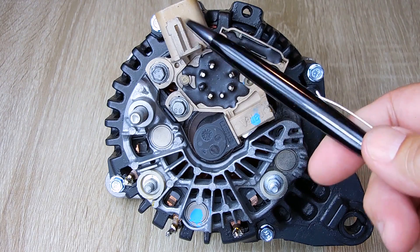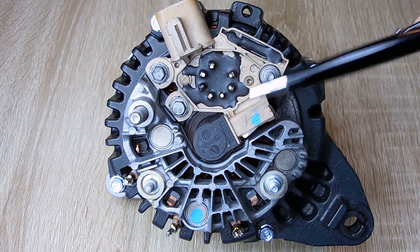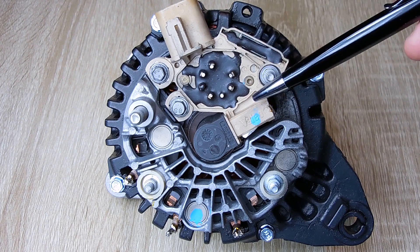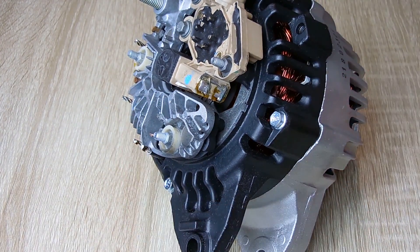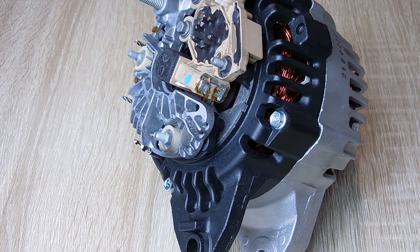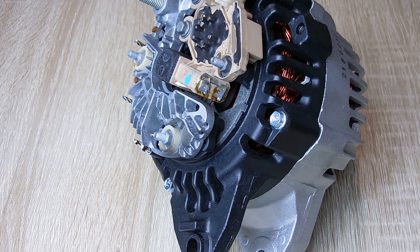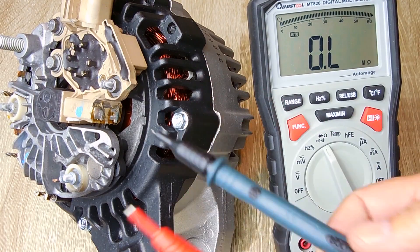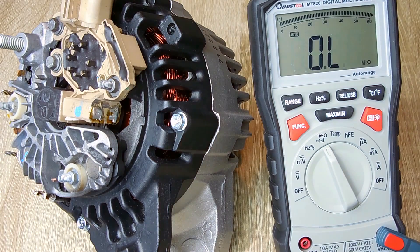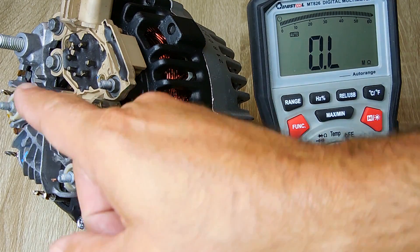With the cover off, you can now see the entire voltage regulator. Right inside these little tubes are your brushes with springs that push on the slip rings of the rotor. To make sure contact is being made between the regulator and the rotor, you measure right over here for low resistance using your digital multimeter — it's usually around 2 or 3 ohms. Touching the probes between the two points, you can see it reads 2.5 ohms. Remember to rotate the pulley while checking to ensure contact is always being made between the brush holder and the rotor slip rings.